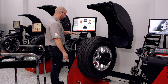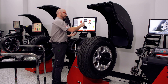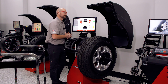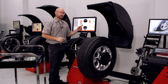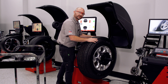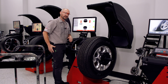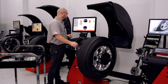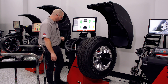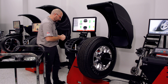The machine stops on the outer plane. It's nicely backlit and has selected our spot to apply weight using the laser. We're looking at an ounce and a half and two ounces on the inside plane - fairly typical for something of this size. We're going to apply those weights and do a check spin. After weight application, the outer planes are at zero, which is great. But there's still a half ounce of weight statically we haven't dealt with. This is called residual static imbalance. While we may have taken care of the shimmy, we haven't addressed all of the up-and-down harmonic we'd feel in our seat and see in our mirrors jiggling. I'll touch the weight plane and the laser will light up center, asking for a half ounce to address that residual static imbalance. Applying it now, then one more check spin.